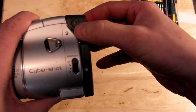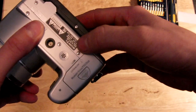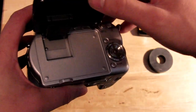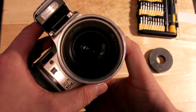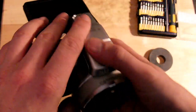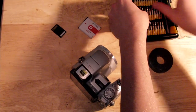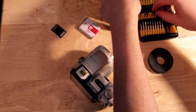These are the locations of the screws that let you remove the back panel. There are two screws that are hidden — one is hidden behind the LCD, which covers the point that attaches the LCD to the main board of the camera. The other one is hidden inside the flash. When you flip up the flash, you'll see one in the corner on the right-hand side. The screws don't have to come out in any particular order, but pay attention to the screw inside the flash — it's a different thread than the rest of them, so put it aside so you don't mix it up.